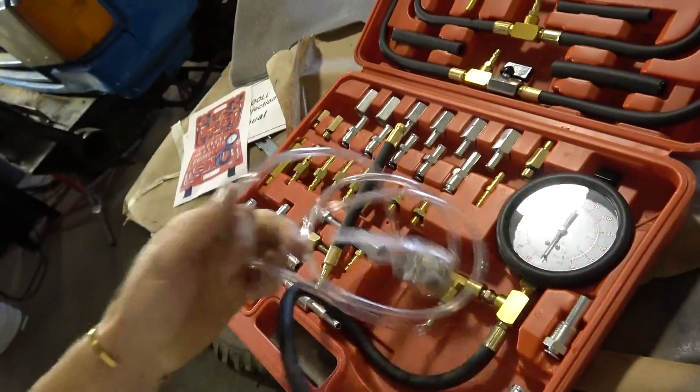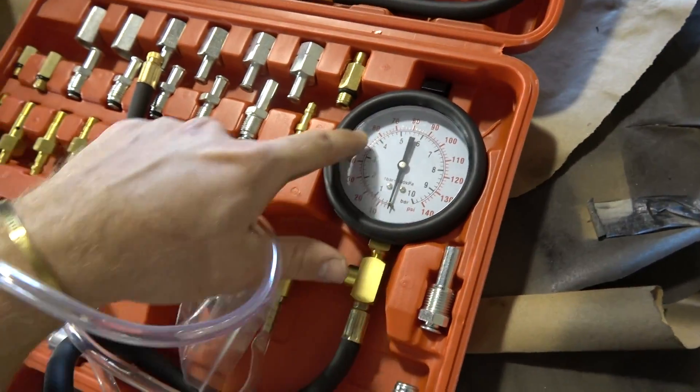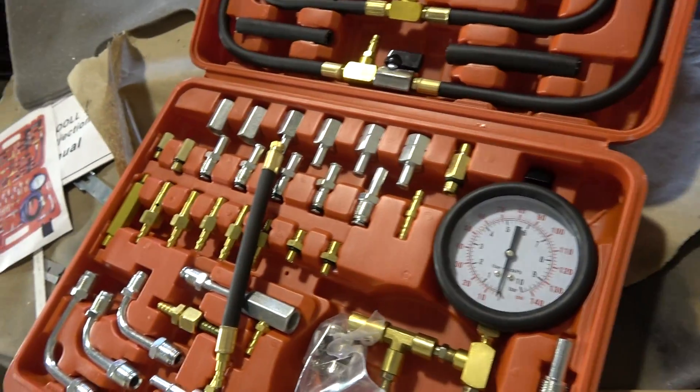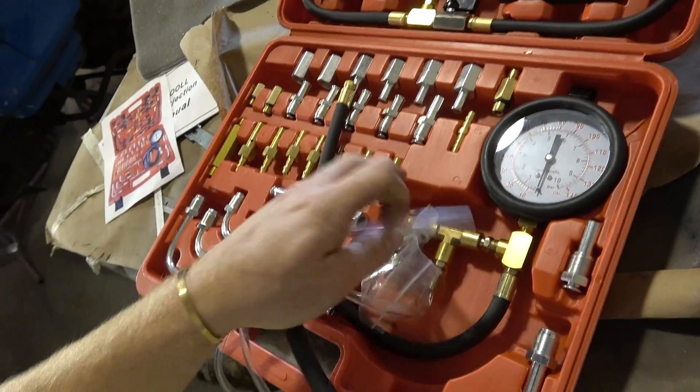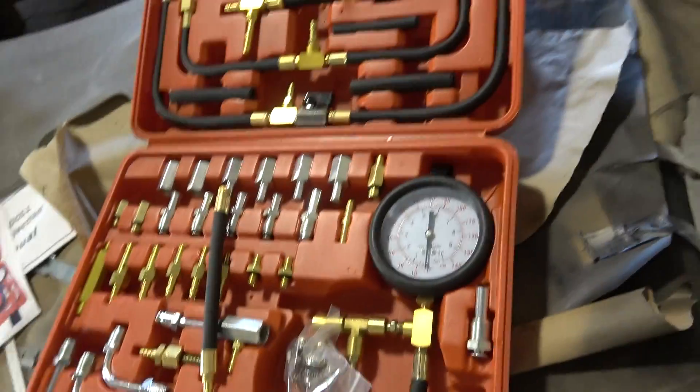It was easy to turn it over a couple of times to figure out what pressure I was getting. Very easy to read gauge — I was right under 60, about 57 PSI or so, which is good. It also has a release valve so you can release pressure and let fuel flow, assuming you have fuel there.